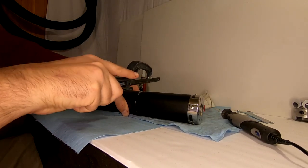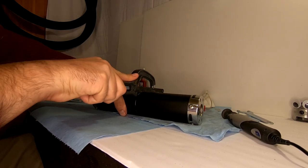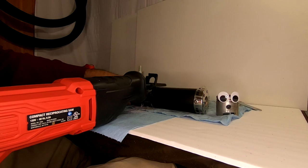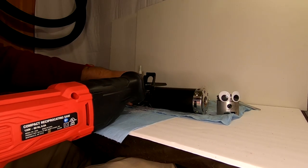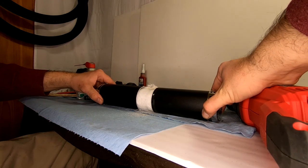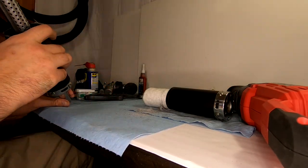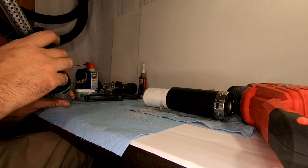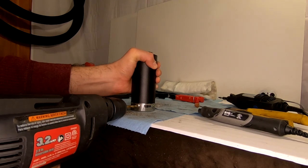Now, unfortunately, guys, I don't really have a good way to do this. I've only done this twice, including the one you see here, and I've also noticed that between the two silencers I bought, each one's a little different on the inner core. Basically, it just led to me using a Sawzall to cut it in half, an angle grinder to remove the inner support steel bracings, and a Dremel to clean up the mess.